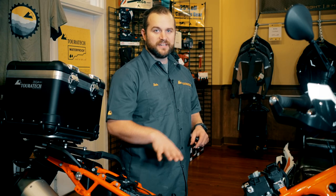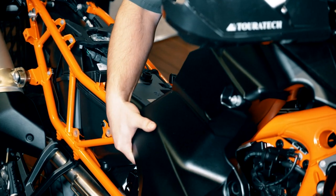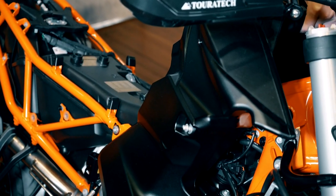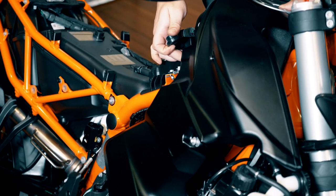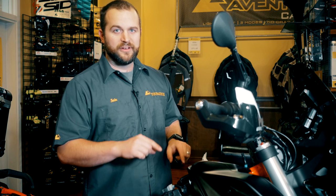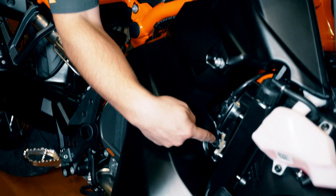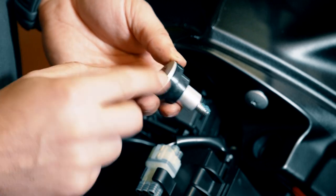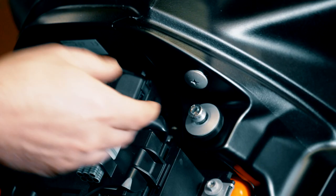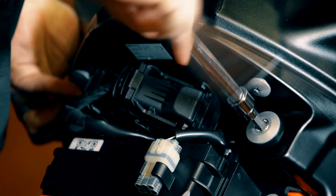The hydraulic clutch kit is now fitted on the motorcycle. It's time to reassemble the bike, starting with getting the gas tank back on. Make sure you have the two rubber isolators for the upper mount positions — you'll need to fish them in before the gas tank is set all the way down. Confirm all four rubber isolators are in between the gas tank and the frame: two on top and one on each side. Install the top two bolts with a little thread locker, making sure you have the aluminum spacer, the rubber bumper, and the bolt itself. Slide the tank forward slightly to line up the bolt holes and tighten it up.